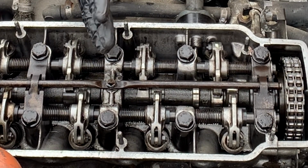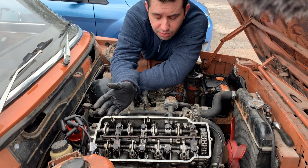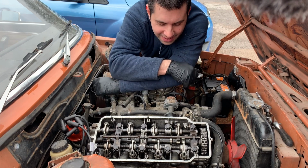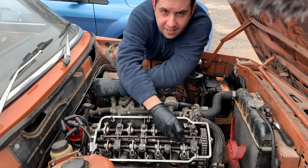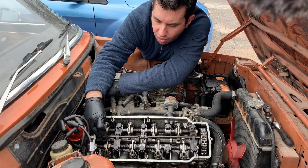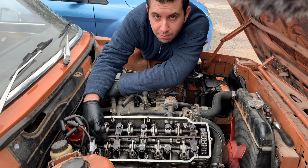The easiest way to do it, as I found, and that's where it comes from in the auto book that I bought a while ago, and also in the BMW manual. Car manuals these days don't tell you how to do half of the stuff. And it's very easy. So when it's TDC on cylinder one, both valves are closed, and the ones on the opposite cylinder, which means number 4, will be on the overlap.